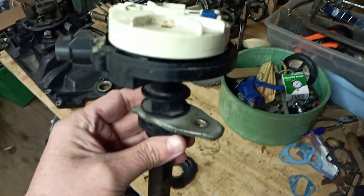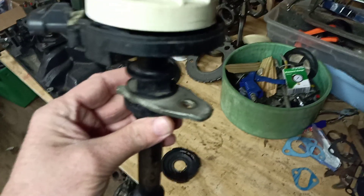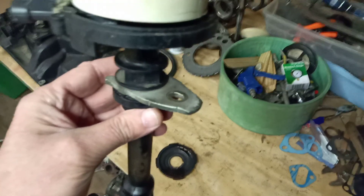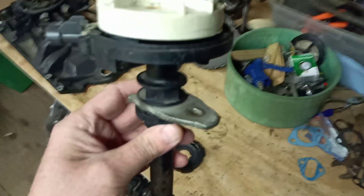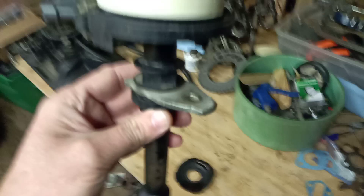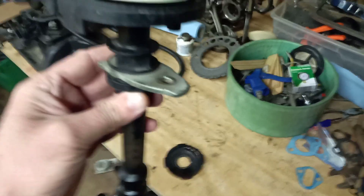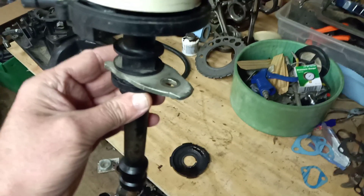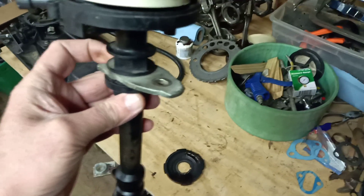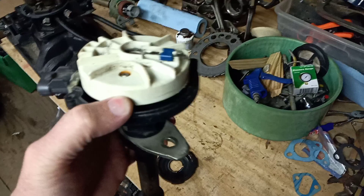These people claim those numbers make the engine run better because you're setting the fuel injector firing timing using that distributor rotation. With the information I'm about to provide I'm going to try to debunk that. I don't have hard facts but with enough common sense and extrapolation from General Motors you can understand where I'm going. I'm not trying to call anybody out — I welcome someone to come back and say I'm wrong, but what I'd need to see is code in the Dodge computer where it uses the fuel synchronization number to time the injector. What I'm about to tell you is it has nothing to do with it.